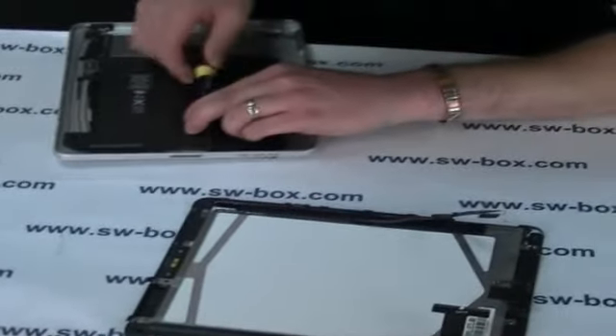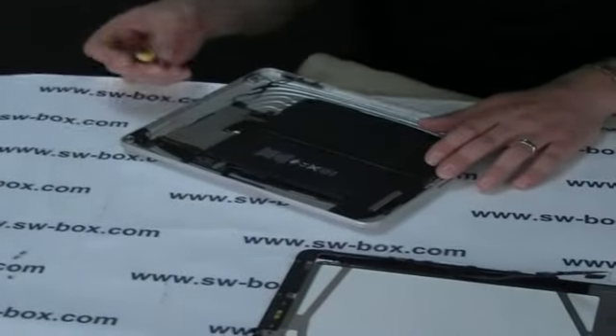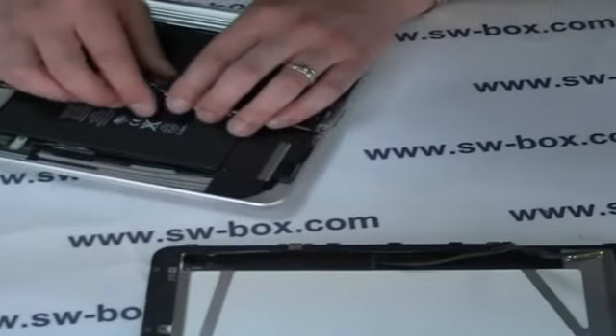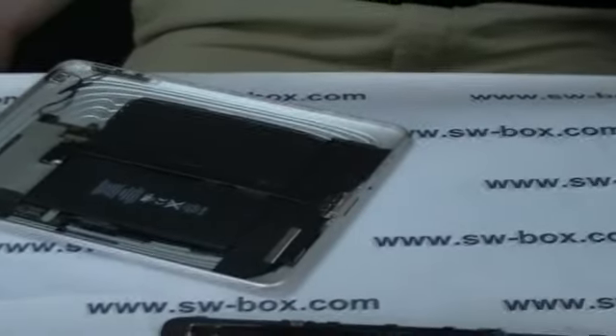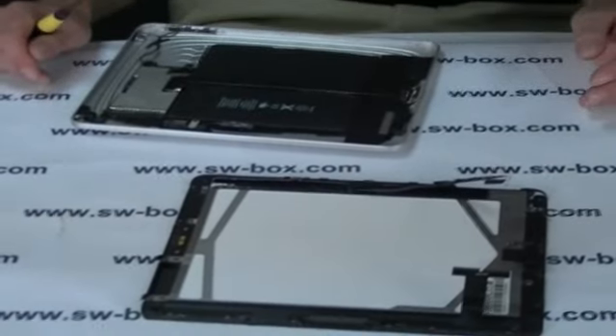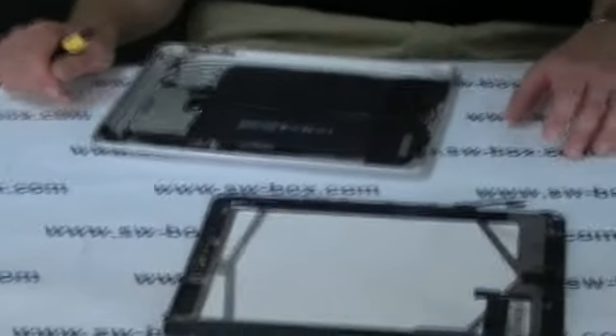So far what we've done, the risk of actual financial loss is relatively small — we're looking at clips that can be replaced. It's not like there's any possibility of you screwing the CPU or memory or anything like that. I've unplugged most of it now — there's not a lot that can go wrong. The biggest danger when you first start is obviously damaging the actual screen, but you can replace it anyway if you've damaged it. To be fair, I was quite aggressive with it in the end and all I did was break some clips — for $2. If you can fix your iPad for $20 instead of sending it to Apple or a repair center, you're in a much better situation.